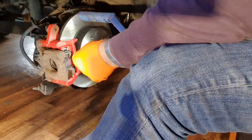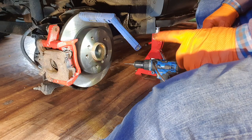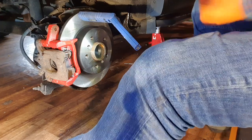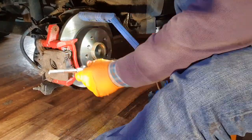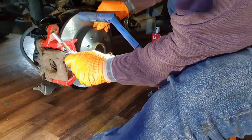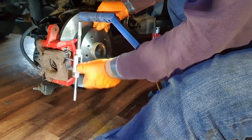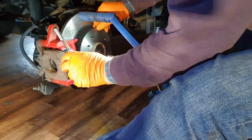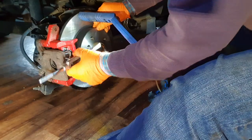Now, make sure this is oil I'm putting on this, and I have to make sure I spray it with spray cleaner when it's finished, because brakes are friction purposed. So now we have to make sure we're straight here, just like that. As I said, M6 is what I'm using, and the grub screws are high tensile, so happy days.